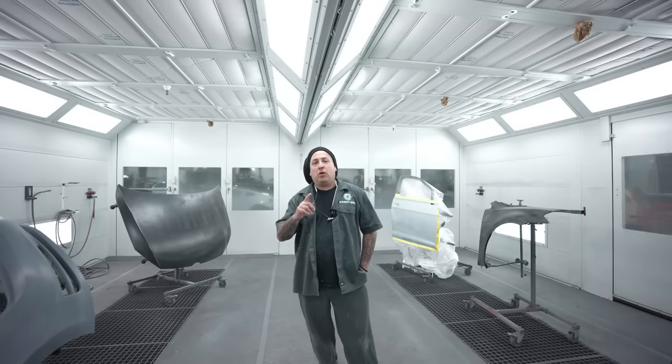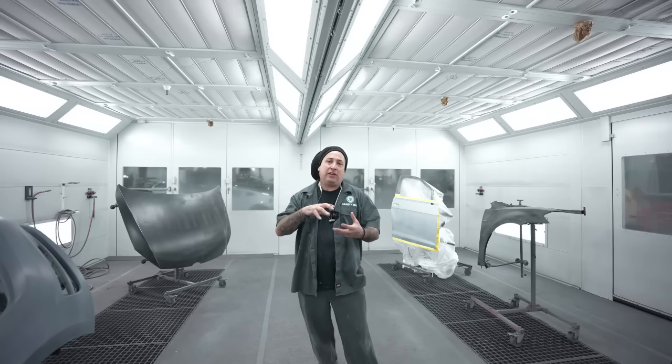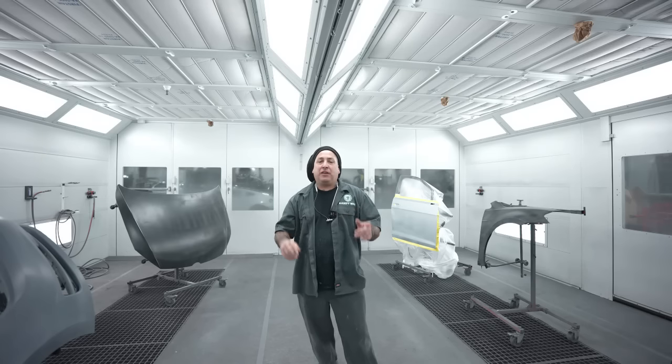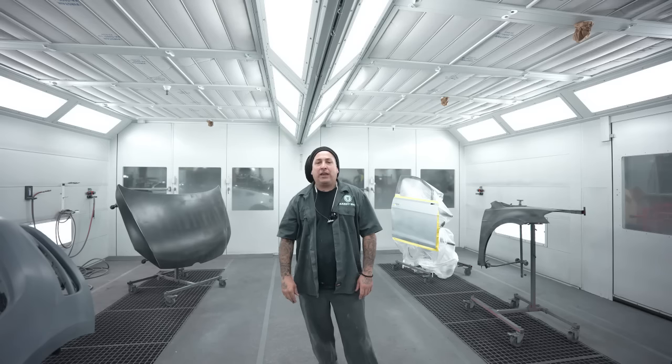So that's definitely one thing that I was happy about that BASF has, as well as the PPG, is that their sealer does stick to the non-sanded parts. I always sand the top, but it's definitely a time saver when you don't have to sand underneath the hoods or inside new parts, and you can go ahead and get that etch right from the product itself. So we'll wait on Patrick, and then we'll start cleaning it and going over the things that he wants us to use for the cleaning process.